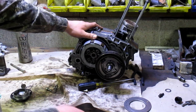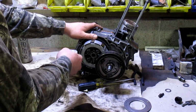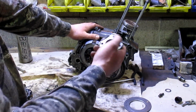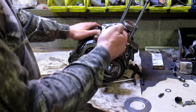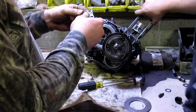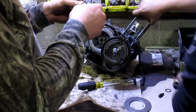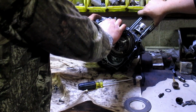Start it up. Now obviously you can see on the back of this it has these 4 little cuts that line up with these shafts a little bit. And on the top side you can see the marks where the bolts used to be. As we twisted them out, I scratched it a little bit. So you can obviously see which way this has to go back in. The bearing likes to fall out all the time. It's only a 6003 bearing, so it sounds like a tiny kung fu fight going on.